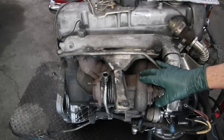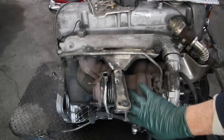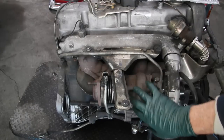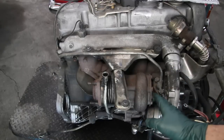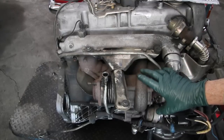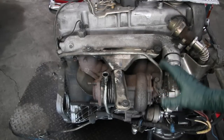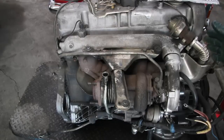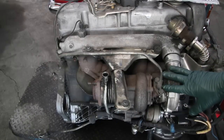It's not so much that the parts wear out — it's because of the carbon buildup, particularly in the turbine section where all the heat is, and you get a lot of crusting from oil seeping out of the turbocharger seals. So I recommend doing this every 150 to 200,000 miles, and once again, if you have the engine out of the car, plan to do it now — you'll save a bunch of time.